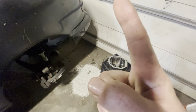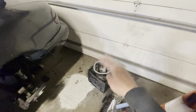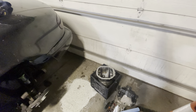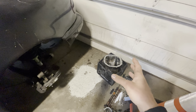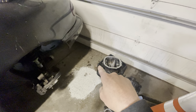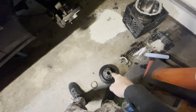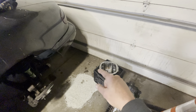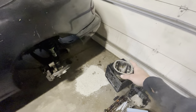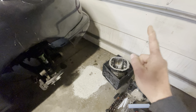That's completely apart waiting for parts. Luckily Amazon next day - the entire kit: bearings, crush washer, new nut for the pinion, everything but the gears because I checked them and they look fine. Shims, seals, new gasket, new hardware for the ring gear - which I'm probably not going to take apart. It'll be here tomorrow, and I've got an appointment the day after tomorrow, Saturday, at the differential shop.